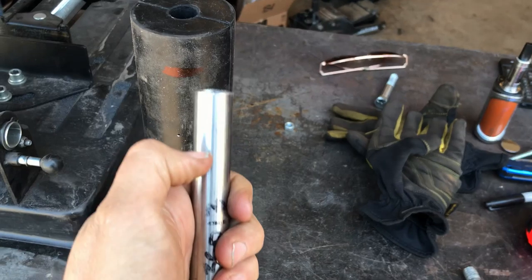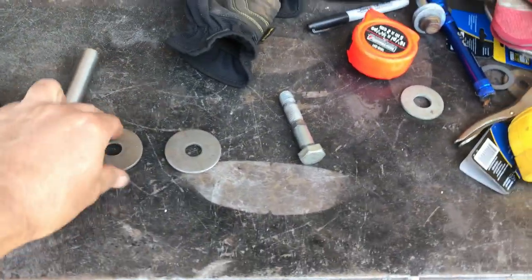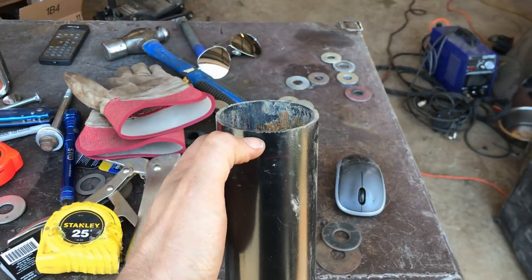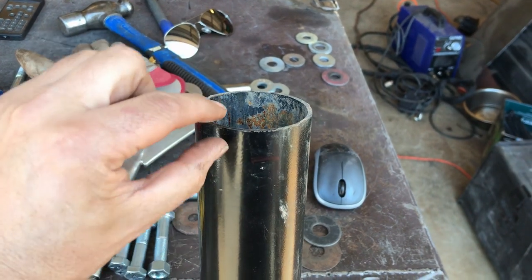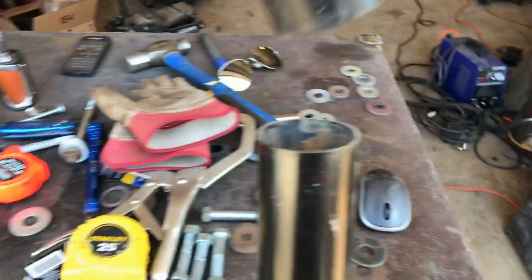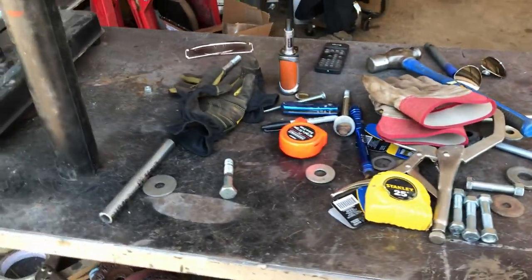That'll go in there. That'll be cut to 3/4 of an inch so that it's sitting inside the hole, so that it allows a bit of compression. Washer will sit in the top, one will sit in the bottom, and my good old foundation pipe. I'm going to cut about 1/2 inch of this, and this little section here will get welded onto the frame bracket. This basically means that when this sits inside here and you squash it down, it doesn't squeeze out like a jammy sandwich. So let me chop all them up and see how it looks.